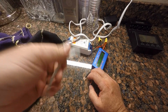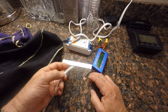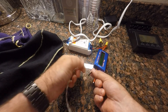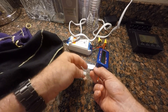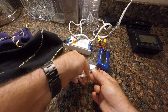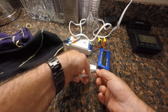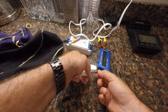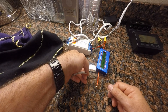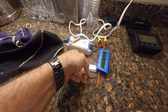The hardest part about all this is these LED strips aren't labeled positive or negative. So I've got a little 12 volt power supply with a wattmeter on it — we really don't need it — but I'll double check because I like to use red for positive and black for negative as I string them all together. If you hook it up reverse polarity, the LEDs won't come on. So figure out a way to test it — a 12 volt battery, even a 6 volt battery done quickly would probably work. Just go through and do that, then make a little pin mark to indicate which one's negative.